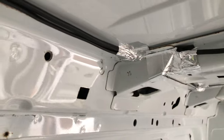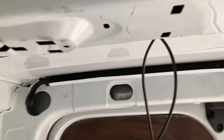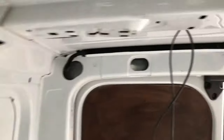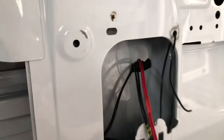To show you — it runs along here. I've put some taping on there to stop any cables moving, but by the time I put the insulation in and re-tape, they're not going anywhere. They won't move with vibration or split or cut on metalwork. So again, the daisy chain through your spotlights — three lots going along to the back — will be wired so the back two spots come on with one switch, the next set with the second switch, and the next set with the third switch. That's your three switches on the panel I showed you earlier.